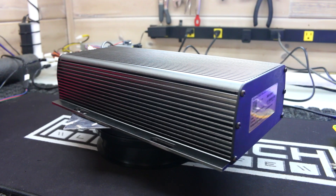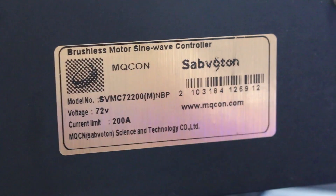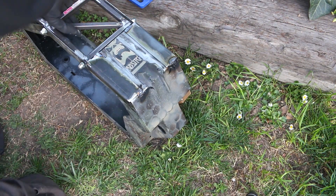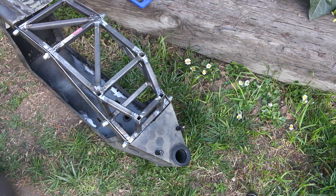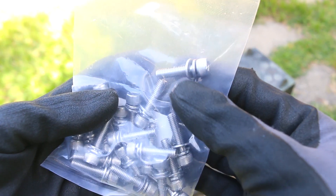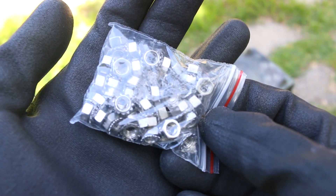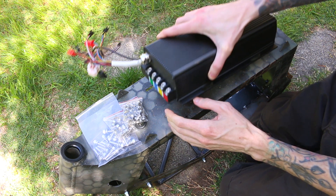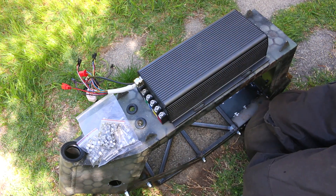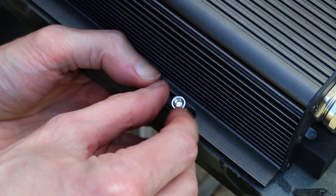Because I got a bigger battery, that means I could use a bigger controller on this build, and this is the SVMC-72200, which is a 200 amp controller, so I should be able to utilize the power of that giant battery. I figured it might be a good idea to just weld the bolts into the frame, that way if I ever need to remove the controller, I don't have to pull out the entire battery. These are the exact length bolts that I need to hold the controller on. The controller mounts up perfectly fine, although after more testing from this video, I do think I want to shift it back more, but we can address that in a future episode.